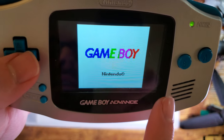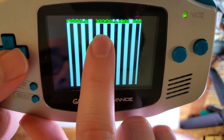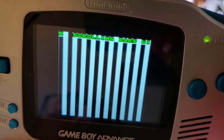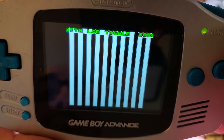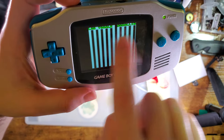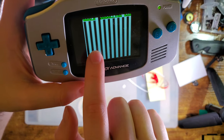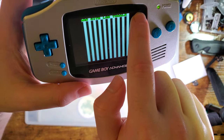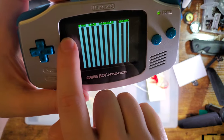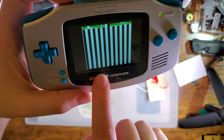So what this does is this is going to show a constant thing scrolling across the screen. And when the letter S in the word scrolling hits the left-hand side of the screen, the ROM is issuing an LCD reset command. So what that does is LCDs are drawn with the pixels row by row, column by column in each row. So they'll fill out a whole row. They'll fill out every column in a row, then move on to the next row and keep going back and forth until you've got the entire screen filled.